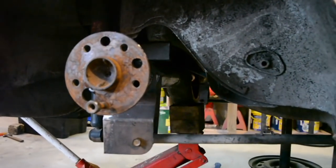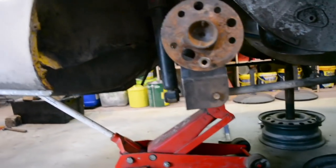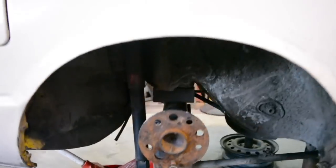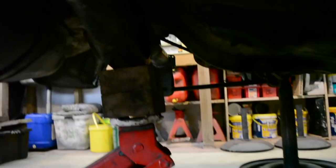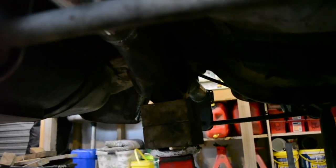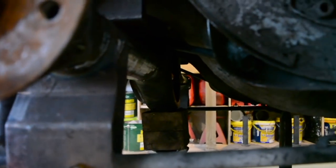Measured off, locating holes that are under there to each flange. So that's all, happy with that. And then I just had to get the pinion angle right. So what I did for that, came to the front of the motor and took an angle off the front pulley, or off the front of the block there, which gave me how far the motor's tilting back. And then I brought that angle finder and stuck it on the front of the diff casing there and got the diff sitting pointing upwards at the same angle that the motor points